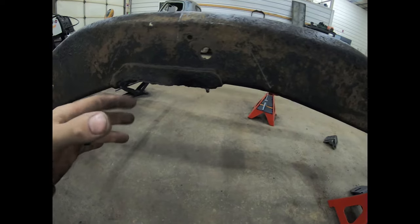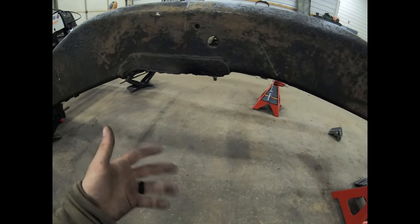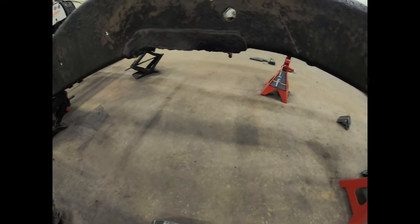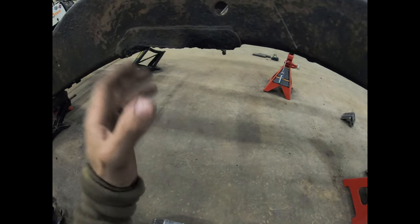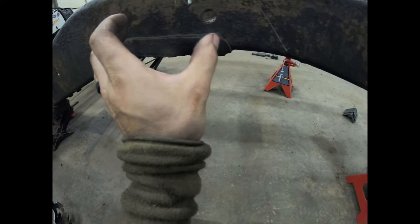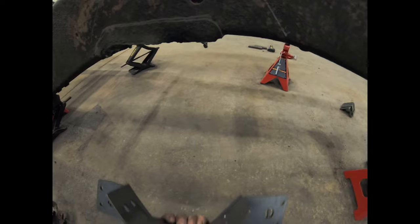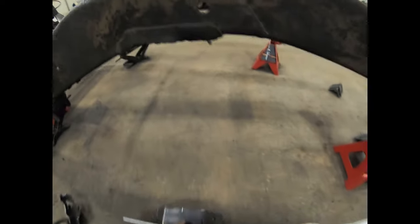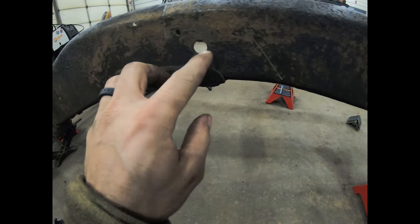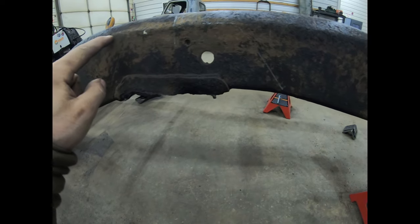This is for my U-bolt length — some U-bolt lengths bolt to the lower leaf perch. When this comes up, the frame is actually going to go forward. So you want to have enough room for that whole unit to nest right under this space here. Once you do that, there's basically a line right in the frame here as a good reference point.